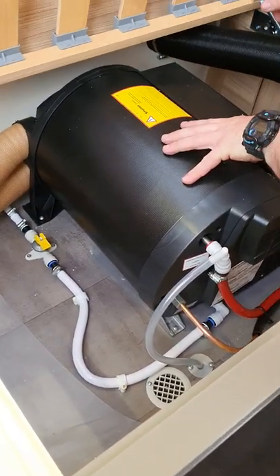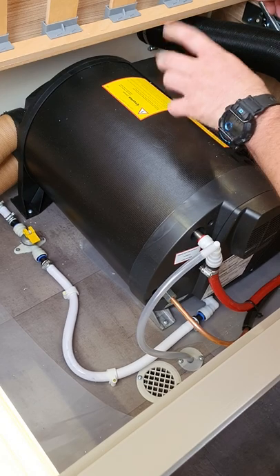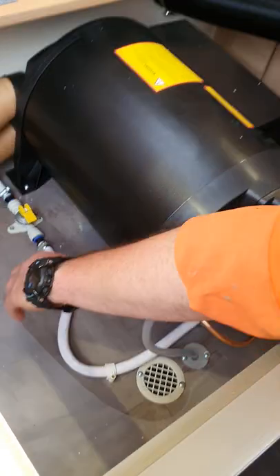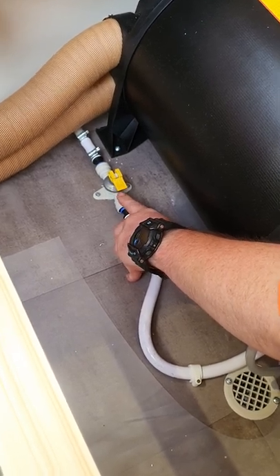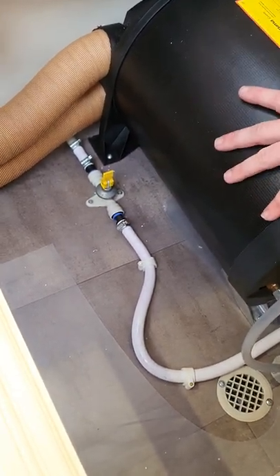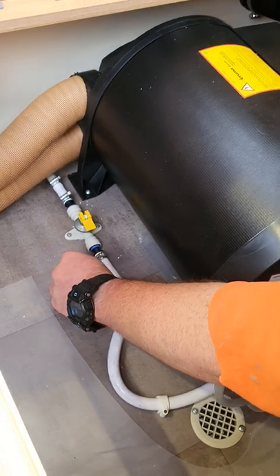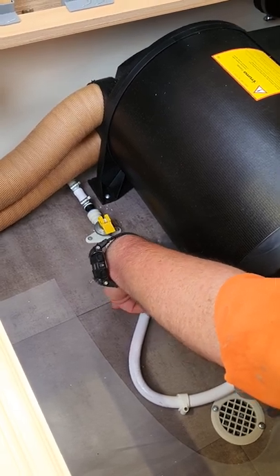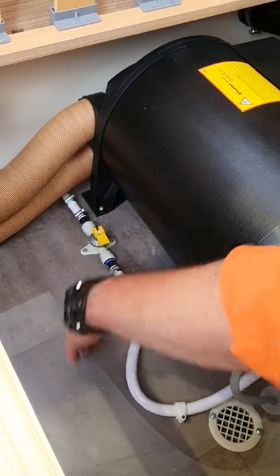This unit here is your combi boiler — it does your water heating and your room heating. Sits under your seat there, just beside the kitchen. Pretty much don't have to worry too much about this — it does its own thing once you've turned everything on. The only thing to know is this little yellow lever here. When you're going to store the van for a long time, especially over winter, just flip this little lever up and it drains all the water out of this system — just prevents anything from freezing or bursting the tank. Just make sure that when you go to use it again, you flip that lever down — otherwise it'll just pump everything out through the overflow in the floor and you won't get any water in your van. So just make sure that's down and then that'll fill everything back up when you go to use it again.